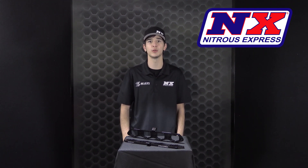These plates are designed to fit the factory 2018 and up 5.0 intake manifold or the Boss intake manifold. The 2018 and up manifolds are a direct bolt-on replacement for any of your modern 5.0 Coyote engines and provide cheap and easy horsepower. This setup is capable of spraying anywhere from 100 to 300 horsepower.